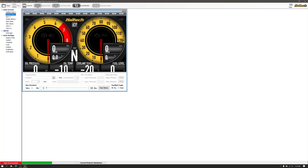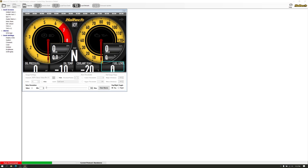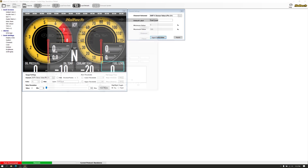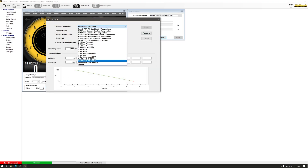One change we need to make is the calibration of our fuel level sender, which means we need to change the ohm range depending on the year, make, and model of our vehicle. For this application, we need to select a 0 to 90 ohm range. Engineers have already pre-programmed a bunch of popular ohm ranges in the ICC software. Left-click and highlight that gauge — here we can see all of the different units as well as the channel itself. On the left-hand column under dash settings, select channels. Because we've highlighted the fuel level already, it already pops up. Select input calibration, and it's already set to 0 to 90 ohms. Click apply and close the windows.